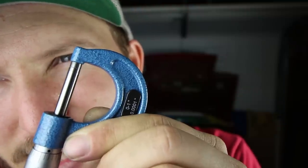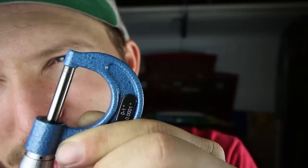I was also able to calculate what the negative lash was on the bad intake valves, number 3 and 7. They had a negative lash of 4/1000ths and 3/1000ths, which means instead of fully sealing all the way and letting the combustion happen, those intake valves, one on each cylinder, were staying open by about that much. That's how much space the combustion had to escape through. And that tiny, tiny, tiny gap is what was causing that engine to run like complete garbage at idle. So that shows you how important it is to be precise when you're setting lash.